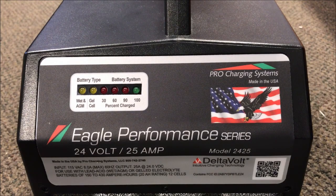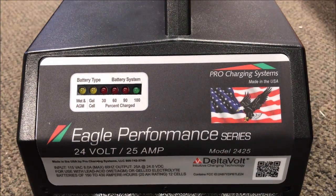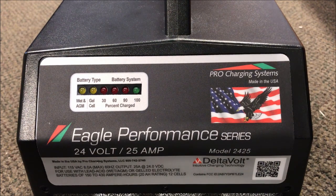The fault code of the 30 and 60 red flashing lights is caused by the charger not being able to raise the voltage of the battery pack to 10 volts in the first 3 or 4 hours of charging, or during the forming stage. You will see this if the battery is extremely depleted, or if the battery has a damaged cell internally.